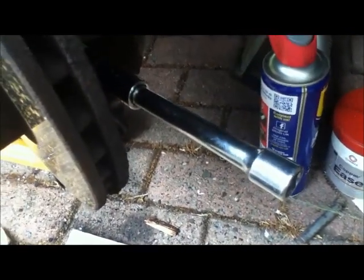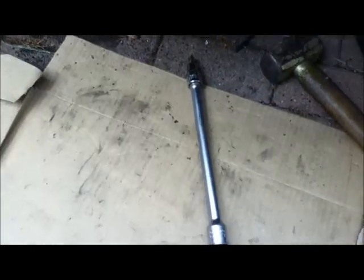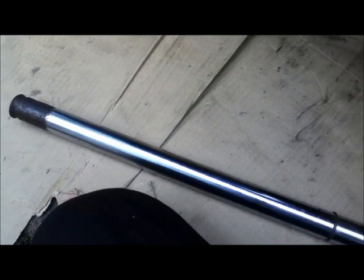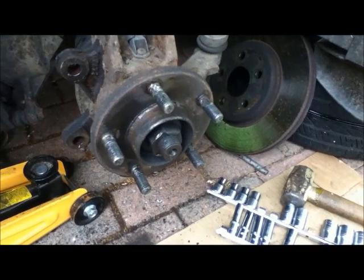Let's see if we can actually undo it. Even with the T-bar and this massive extension arm — the stanchion from a Yamaha RD200 — I can't get any movement in this at all. It is absolutely solid. I'm going to try heating it again, get it hotter and hotter. I am really struggling now. I cannot undo this pinch bolt.